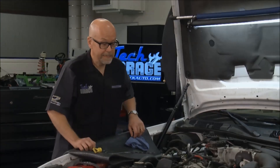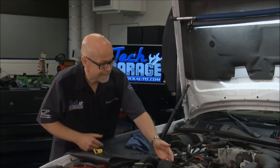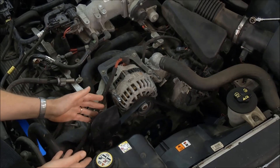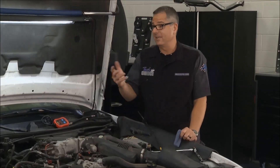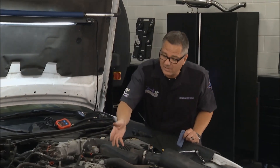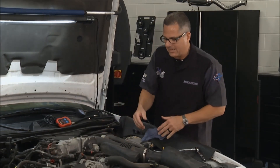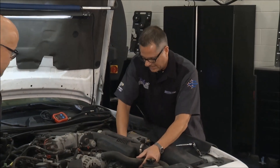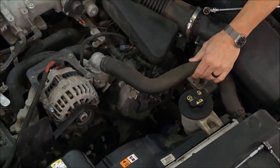The belt as well — with this many years and 50,000 miles, I wouldn't even spend much time inspecting it. It's so inexpensive; just replace it. Replace the tensioners too. The tensioner and the pulley — we'll probably knock it all out. We have problems if that breaks, so it could be catastrophic failure. We also went ahead and checked the hoses. With this many years, we're going to go ahead and replace them all — the upper and lower.